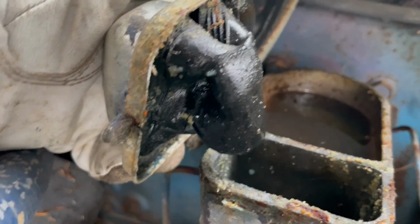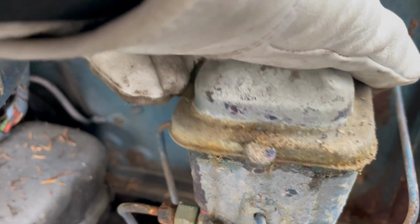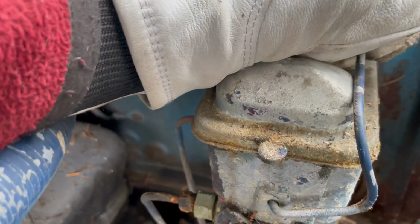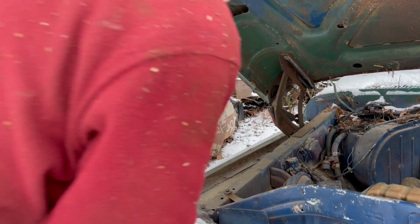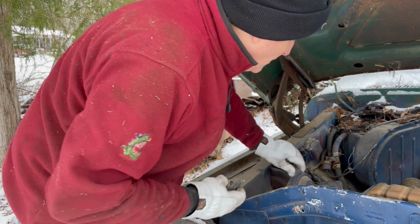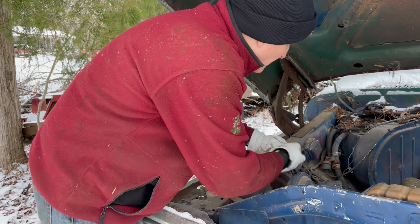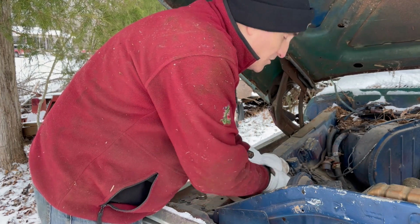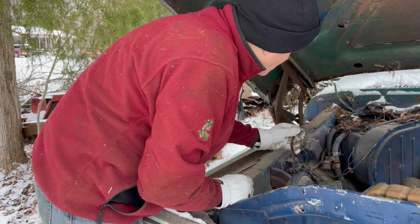Alright, so as far as the brakes go, looks like the front brakes have plenty of fluid in them, the rears do not, so it might have a blown line. So it appears to have some semblance of brakes, and it must be the fronts. Plugs are all checked, they're all fine. There were a few that were finger tight. Don't know why, always worries me when I see that. But there are so many threads on these plugs. The Ford plugs are super long with a lot of threads, so I don't think it was causing any real problem.